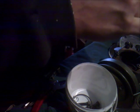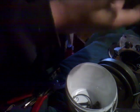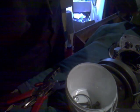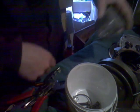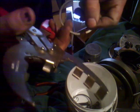because you have to get over the other ring, and that's not so convenient. For the oil scraper ring, it's not so difficult, because you could slide it also from the bottom side over. But for this groove, first assemble the bottom ring and then the top ring. And as well here, look at the marking top. Put the ring inside.